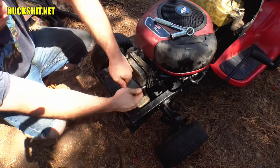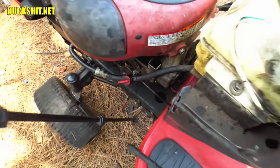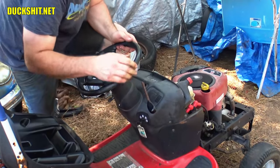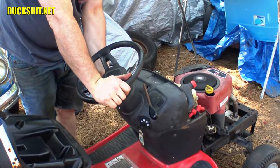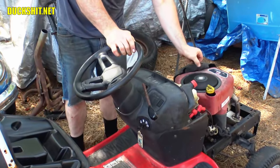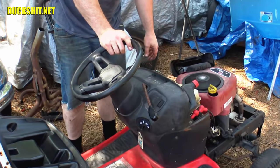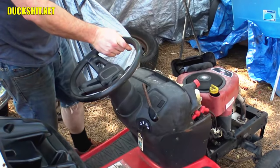Let's try it again — and nothing! Oh wait — Dad installed a fuel switch! That explains the note on the dashboard. And now we have fire. It's running a little choppy, probably because the carburetor linkage is all bent from the chain being on it, and the carburetor is likely dirty from running about 5 years and sitting for about 5 more. But this engine will probably get a proper round-slide carburetor down the road and the governor will be removed.